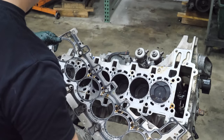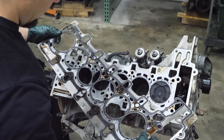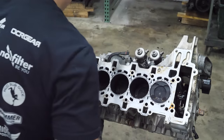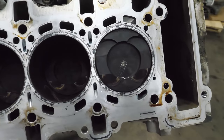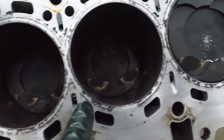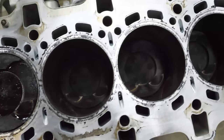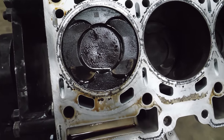It's a mighty thick head gasket — that's one of the thickest I've ever seen. It does look like it is S55-specific because it says so. Well, right off the bat we've got problems. Anytime you can see the outline of a valve on a piston in every single cylinder, it's not good. That's generally a situation you would like to avoid in your engine.